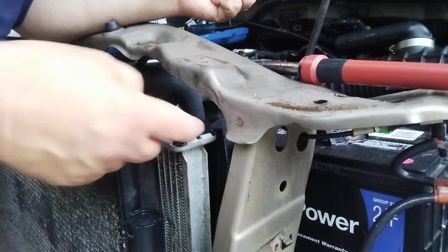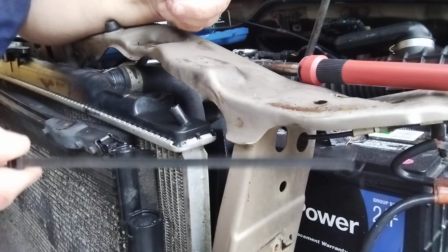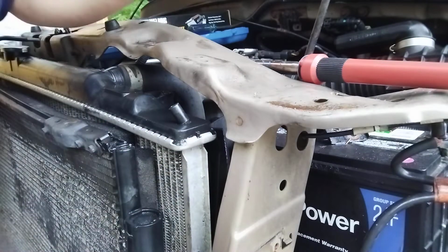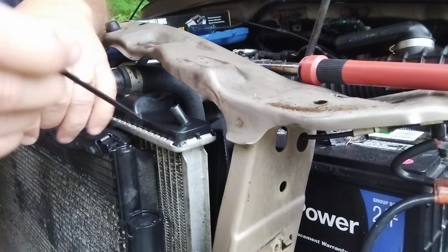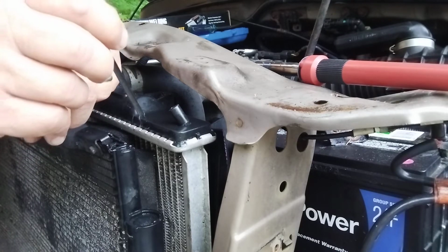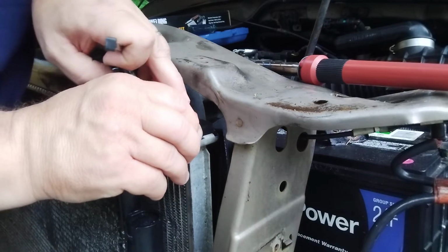these radiator pieces are actually made out of nylon. So guess what nylon is in plastic? A good old zip tie. So you can use plastic zip ties. On my Sport Track, I welded up the radiator. It was cracked around the neck, using zip ties. It lasted 2.5 years or something like that, and it didn't give me any problems. Held pressure, no problem. So today I'm going to try to weld up this pin on this radiator for the kids so that they can drive the vehicle again.